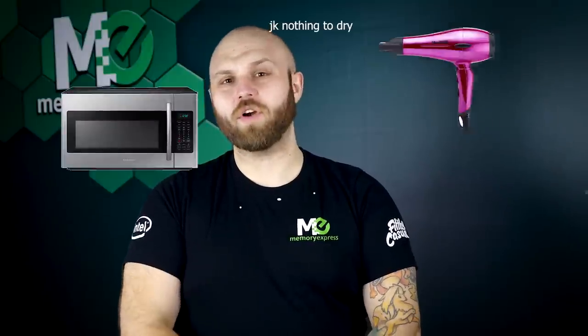What do microwaves, hair dryers, and vacuums all have in common? They have a high electrical signal and may cause interference with Powerline devices. So avoid plugging in the extenders anywhere near these high power draws. Note that if you use a microwave while vacuuming, your internet may suffer. Also make sure it's on the same electrical circuit — all outlets in your house are most likely on the same circuit, but you might be in a situation where they're not, and this may be the cause of your issues.